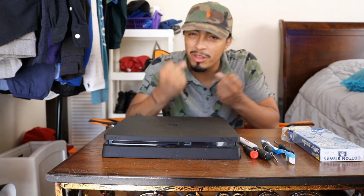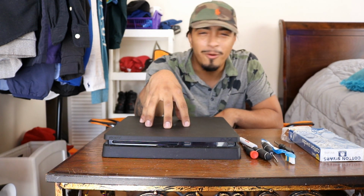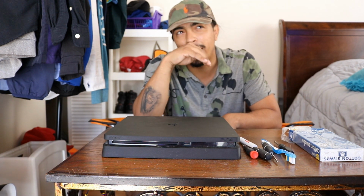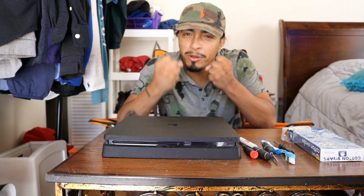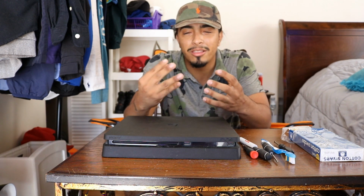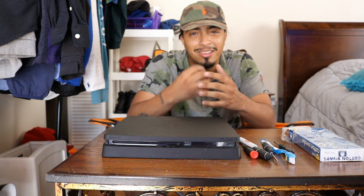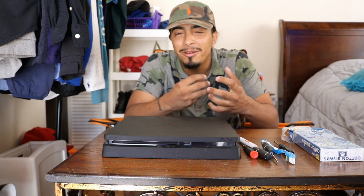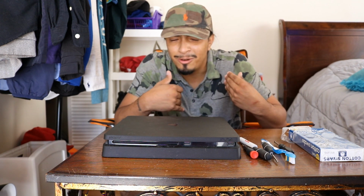Well, most of the time the problem is that a lot of dust builds up in the PlayStation. If you've had your PlayStation for like 4 years, I've had mine for 4 years so far, maybe longer, a lot of dust builds up in the system and clogs it up. Then when the system starts heating up, the fans keep going crazier and crazier because there's so much dust built up. You know what I'm saying? And yeah, bro, let's get to it.